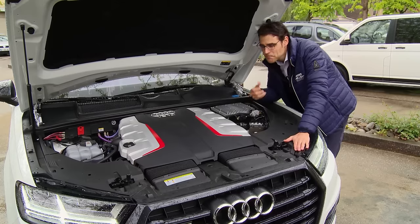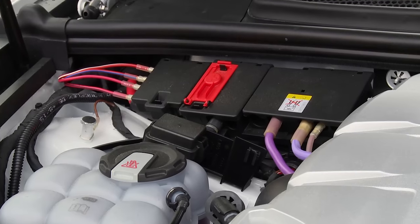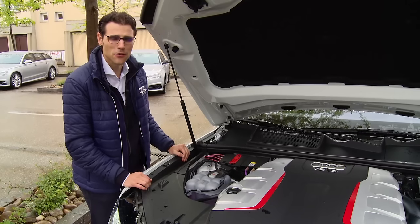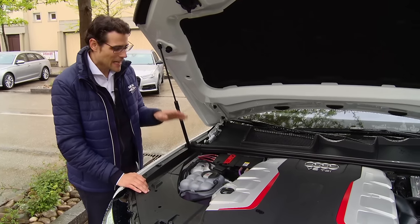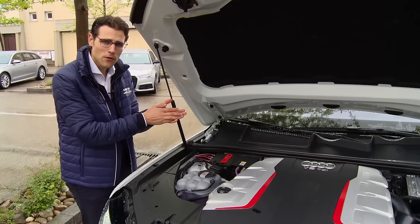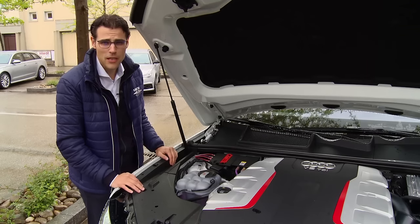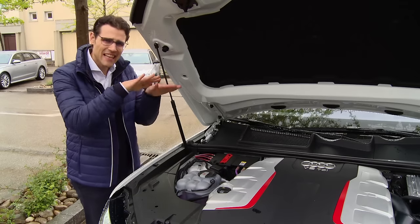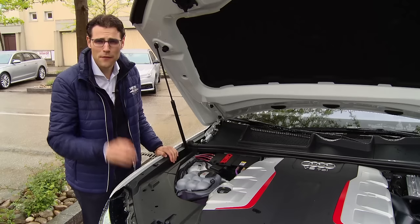I think it's a little bit over-engineered, but it enables you to have power at any time. The big news you can see in the close-up is '48V.' That's the real new technology we previewed two years ago in an RS5 concept. They've changed the car's internal power supply from 12V in parts to 48V, to power the supercharger — that would be 'Verdichter' in German — and also to power the electromechanical anti-tilting function, which reduces body roll in corners. We'll get into more details when we drive.